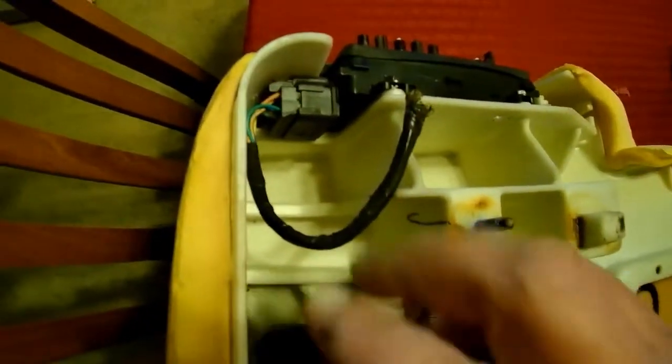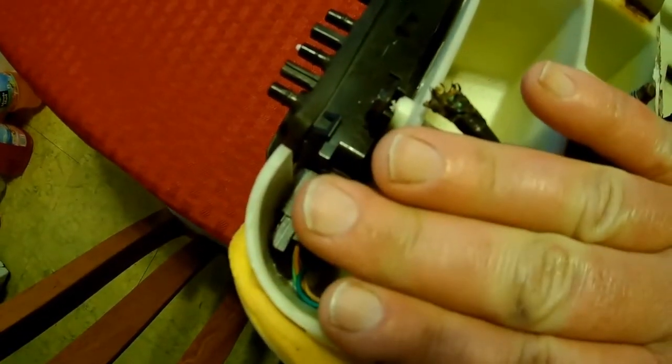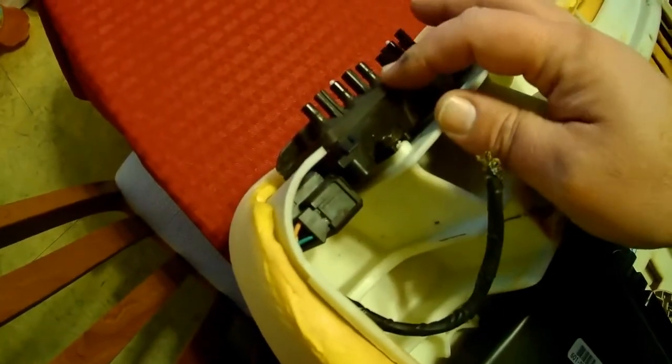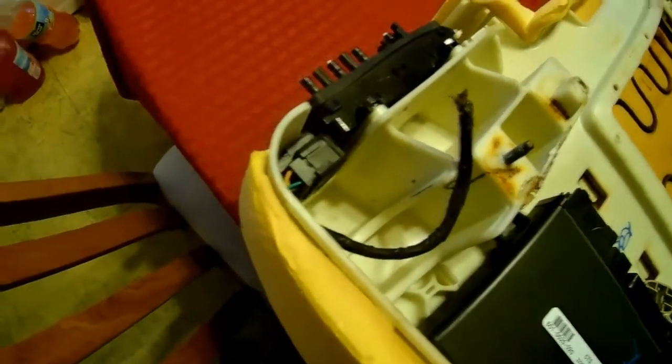So the last plug to get out is for the power switch assembly over here, and they really made this one difficult on you. So you have leather that goes around here and covers here a little bit, so you got to unlatch the front of the cover, pull it down, and then down inside here you need a flat blade down inside there and press the button, and then you can kind of work it out. I couldn't do it. I ended up just cutting the wire in the junkyard, and then you have this whole assembly you may end up having to take out first, but I just cut the wire off, brought it home, decided to work on it there.